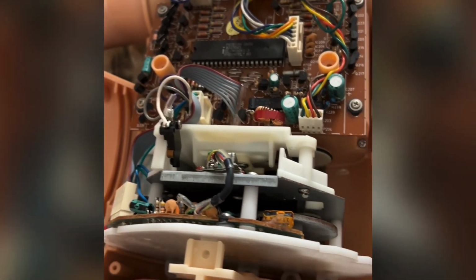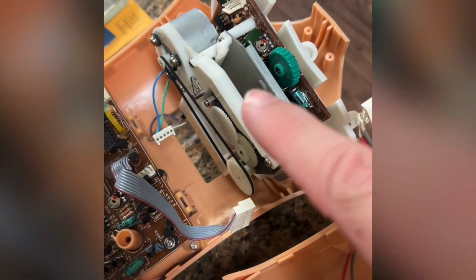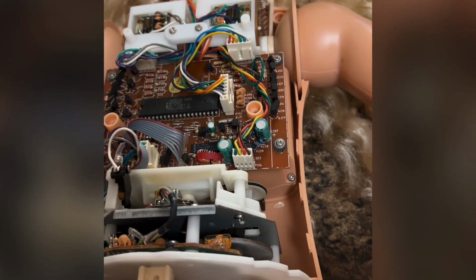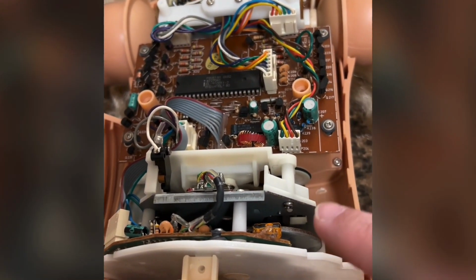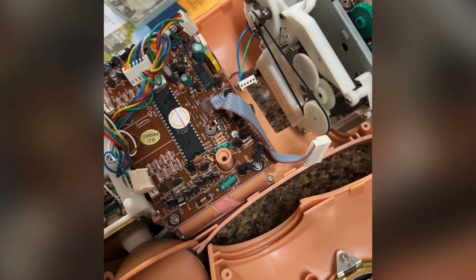Anyway, I'm going to take her legs off, and I'm going to take this cassette player and move it over here, and I'm going to try it. I'm going to move it because I know she works. So if I put that other cassette player in here and she gives me the same problems, that lets me know just from deduction that the tape player is the problem. And if I put this one, which I know works, over here and it plays again, that just confirms it.